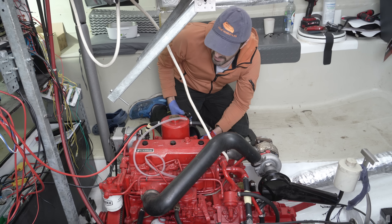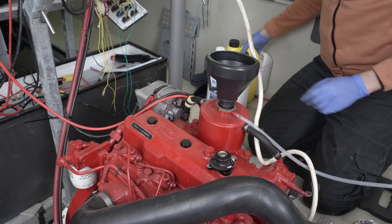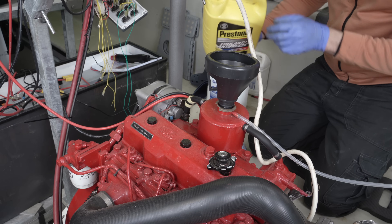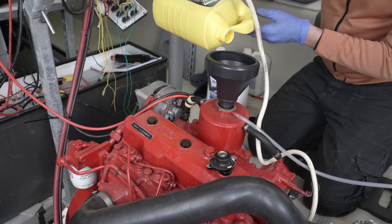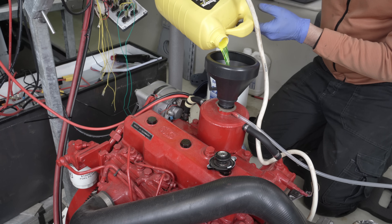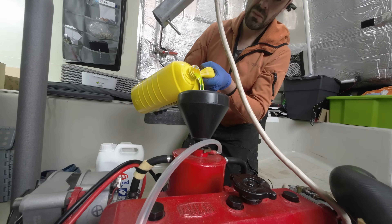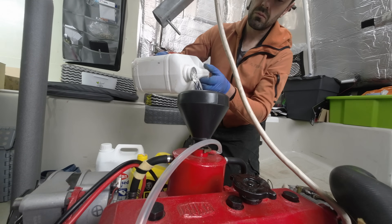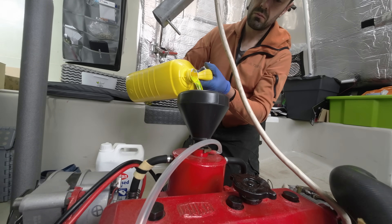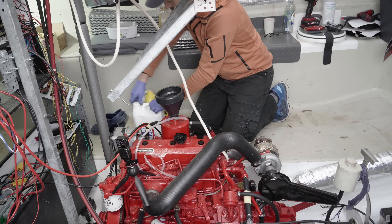It's a bit annoying, but I can't do a really, really good flush-through. Anyway, time for new coolant. I've researched various coolants, and I'm not going for a waterless coolant. Besides the cost and the fact that it's not easy to find in random shops around the world in case I need to top up, the main issue is that you need to completely empty the circuit of residual water first, and I can't do that. Instead, I'm going for a good quality coolant in concentrated form, and then choosing a one-to-one ratio mix with deionized water. It's the richest ratio the coolant company recommends to get the best cold performance, but still allowing sufficient heat transfer. I could have pre-mixed it in a large container and stirred first, but I have it on good authority this technique of alternating from each bottle works just fine.